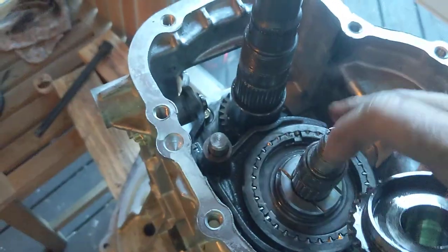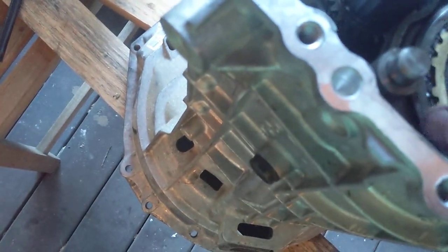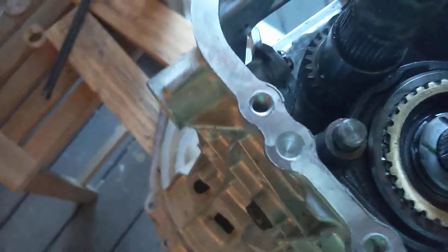So now I'm getting those two roller sleeves that I found earlier that I mentioned. I'm going to drop one on the shaft, two on the shaft. Don't forget your other synchro, which I dropped down here, the brass ring. That one drops in here, and again, has to go in the proper way.